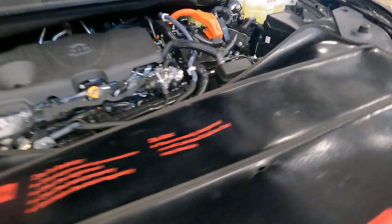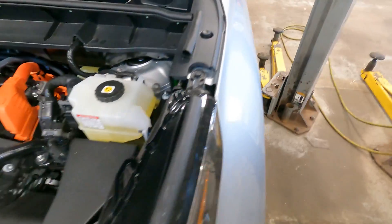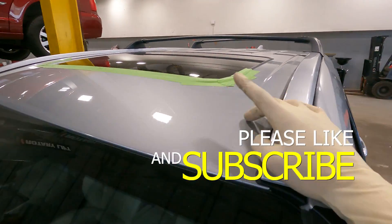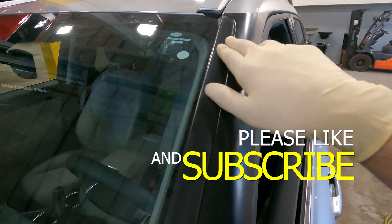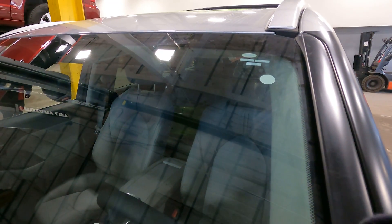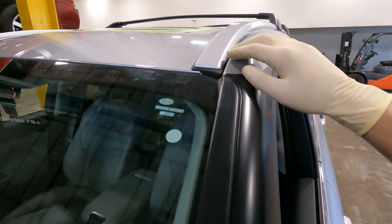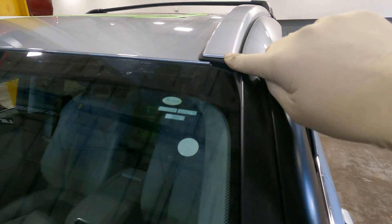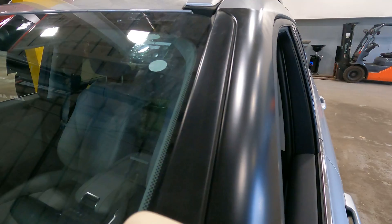So we went on multiple road tests. What we did was we taped up the windshield right here — oh look, the sunroof is still taped, I forgot some tape. I taped the windshield off and went on a road test. Noise is still there. Then I taped off right here because it looks like there's a spot of interest. The noise was still there.